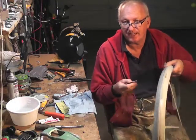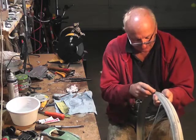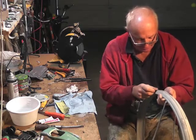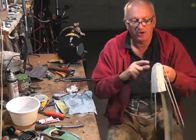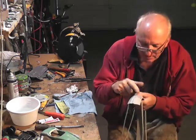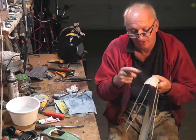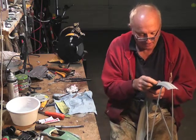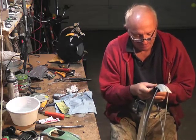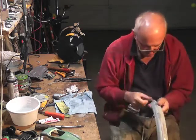I'm in the process of sanding the mudguards of the rally bike. I filled them yesterday and I'm just getting rid of the excess filler to start, seeing if it's smooth enough for spray painting. I do a grey undercoat so I can see the faults. There are some dimples in here where they riveted these units on, but that's basically how the bike was when finished, so I'm leaving them to give it some authenticity.